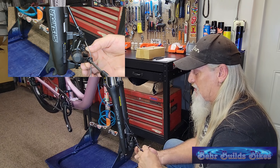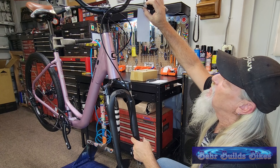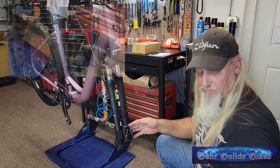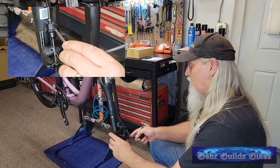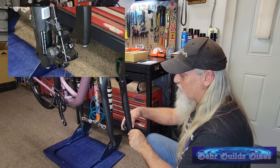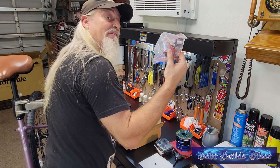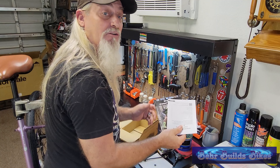Tighten up on it just a little bit. You also want to make sure that the adjuster barrel at the top is all the way in — you want to give the customer the ability to adjust that. Now, because this wheel has never been in this fork, we're going to loosen up the caliper bolts so we do not damage the rotor when we put it in — that gives us freedom of movement so it won't pull the rotor when we slide the wheel in. In our parts box we have our pedals, reflectors, front skewer, owner's manual, and the technical data sheet.